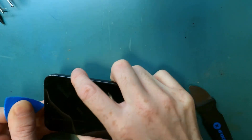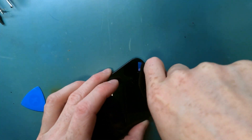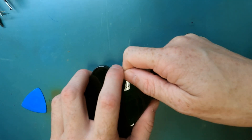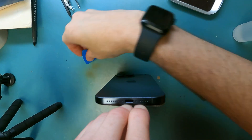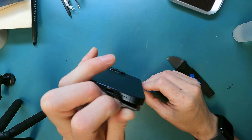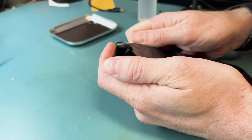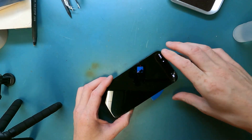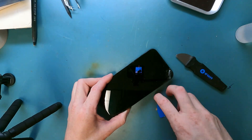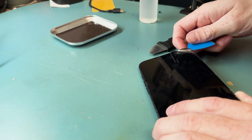Just a reminder — you'd want it to be like too hot to touch. If it's not hot enough, it's just gonna be really hard to take off. Prying it off is really hard, and I have it sped up in the video here so you guys can see me pry it off. But it is something you want to take your time on, especially use a lot of heat. Use a heat gun, a heating pad, or even a hair dryer if you wanted to. It looks like the phone is still intact and working as I pry it off, which is pretty great.